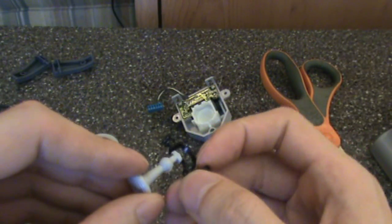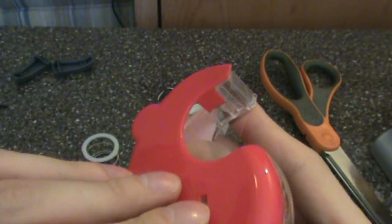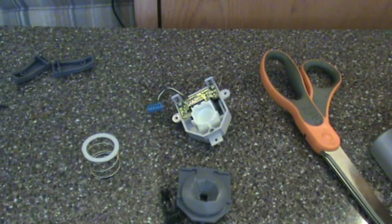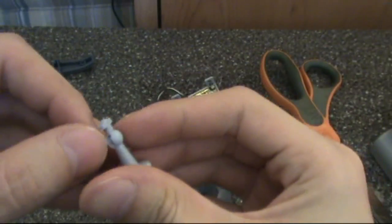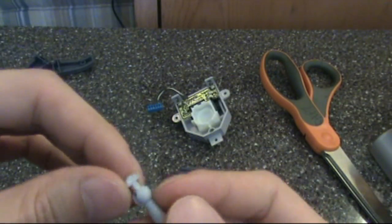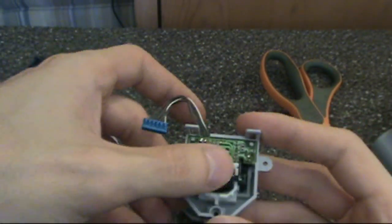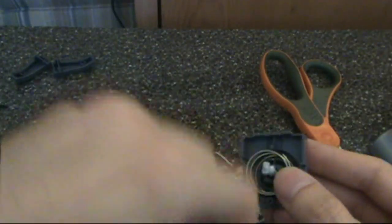Fortunately, all you have to do is apply tape — natural stick enhancement, no prescription required. Different people will recommend different types of tape: thicker tapes are easier to work with, while thinner tapes give you more control over subtle corrections. Cut a strip of tape as wide as the two contact spots on the control stick; the needed length will vary based on how worn down your stick is. Cutting tape this thin, especially scotch tape, is extremely tedious. If using scotch tape, I'd recommend a matte finish as the clear shiny finish is almost impossible to see. Err on the side of too thin, as you can always overlap to even it out. With two strips completed, just wrap each one around one of the spots.